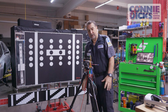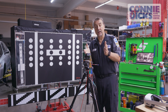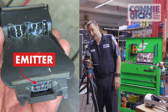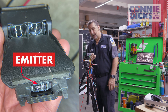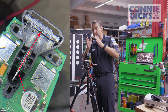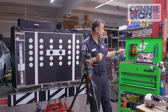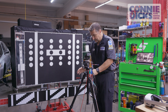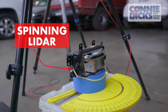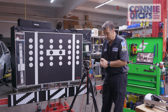It's a very small, simple-looking sensor. This is a solid-state LiDAR system. The very bottom section is where the output is — the imager outputs a signal through a special lens. The second sensor is a mechanical rotating LiDAR sensor off of a 2019 Audi A6, and it's a scanning LiDAR system.